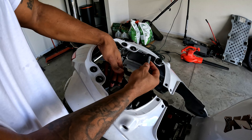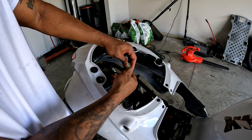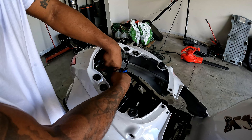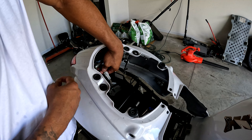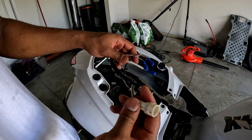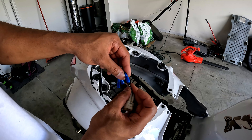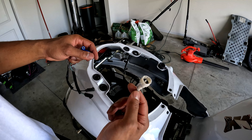Pull up on this tab and pull — pull up on this tab and pull. Then for the OEM wire harness, press down here, keep this apart, and you get this off. There's a little click tab right here — push that down and pull that off. All this will be connected like this. You can see the brown wire right here, white wire right here, black wire right here. All you've got to do is cut these three and then you can toss this — it's useless.